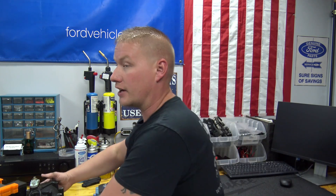We need to investigate further. The next thing you want to verify, with the vehicle in park and the AC system on, is that the cooling fans for the engine actually come on. On all Ford units, it's in the PCM strategy to turn on the low speed cooling fans to get airflow across the condenser as soon as the AC is turned on, no matter what.